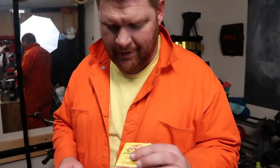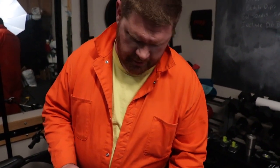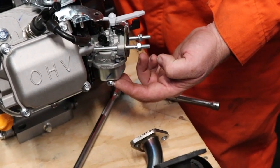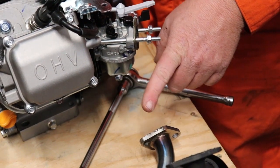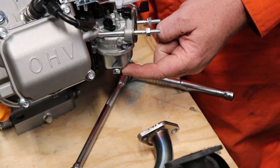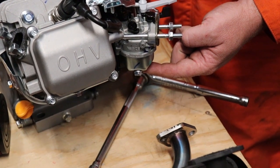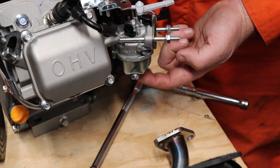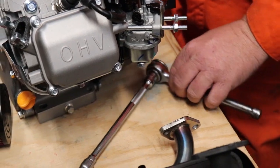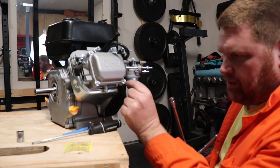What is a good idea to put on right now is the carburetor jet. Everything is cleared away from it and it's easy to get to. You'll notice on the carburetor there are two 10 millimeter bolts. One of them is angled off to the side — that's the carburetor drain. The one that points straight down holds the bowl on. This is the one that we want to remove, so we're going to remove the bowl and that allows us to have access to the carburetor jet. So we're going to pull the carburetor bowl off.